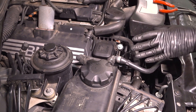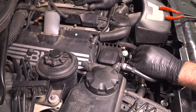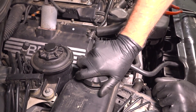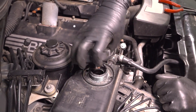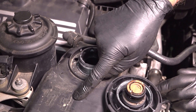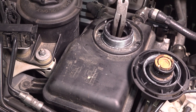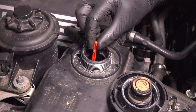After that, we're going to shut the vehicle down and let it cool completely. Make sure it's nice and cold because you don't want any pressure in there. Then double-check the level — take the cap off, make sure there's no pressure. Adjust the level again so that it is at max. You can see the little keyway on the side, so that should float to max.